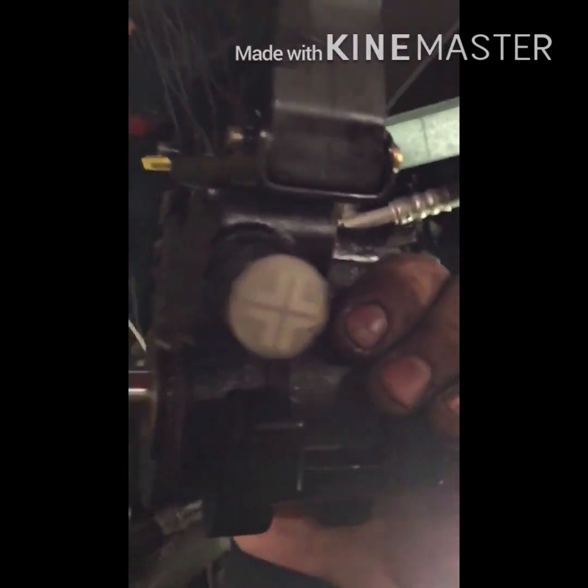Nice and easy. Sits like that. Now we can put the new one in. Now we grab our new one. I like to loosen up this plug on the bottom just so it's finger tight. And then, nothing special there. Slap her back on, put the 3 bolts in, and then I'll show you what's next.